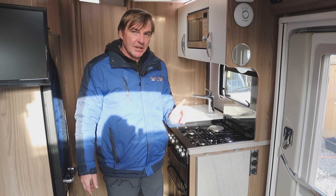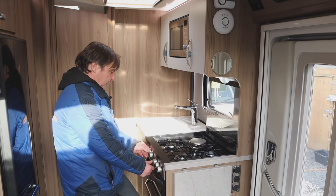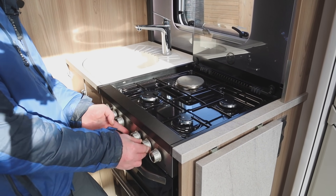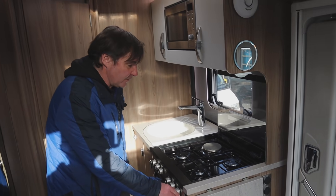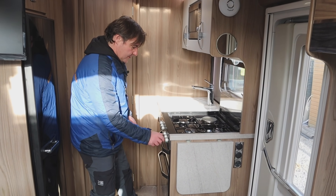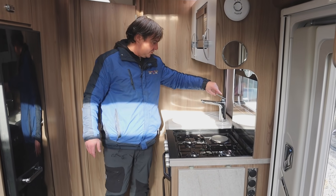What we can do while we're waiting for this to prime up - we have switched the gas on - so let's bring the gas through. I'll put the hobs on. Now if you have swapped your gas bottle over, you will have air in the pipe so they will take about three to five seconds for the gas to come through. As you can see that's all lit, so we've got the gas coming through to the hobs.